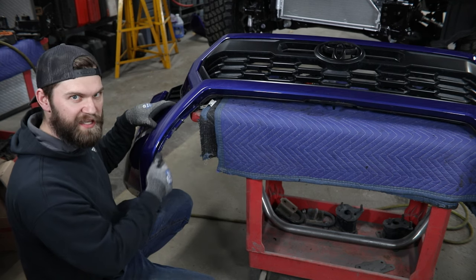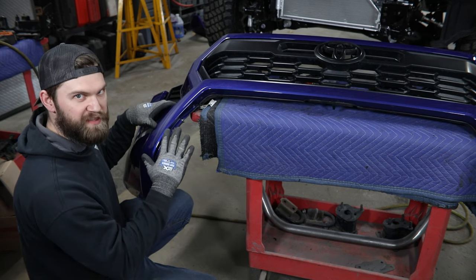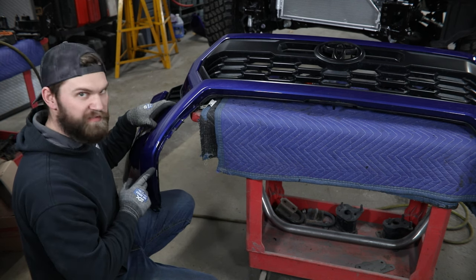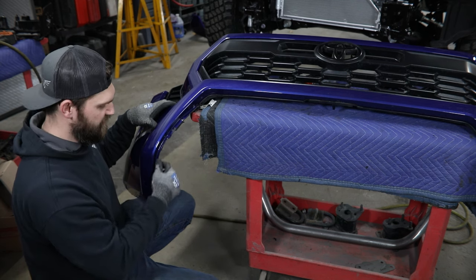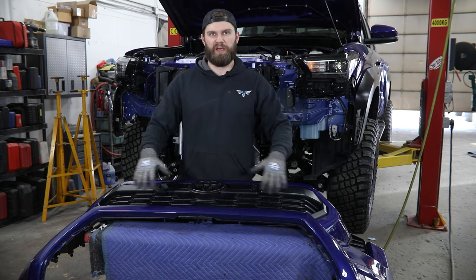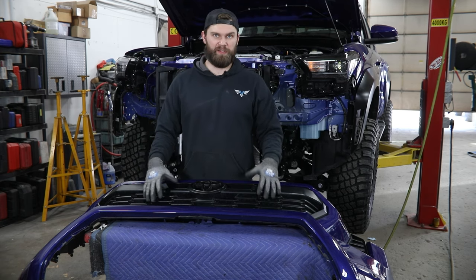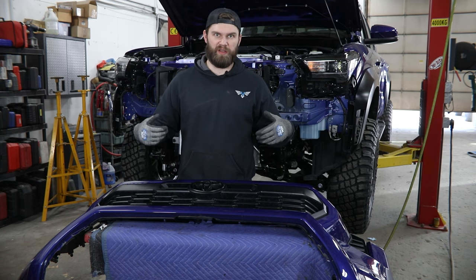Flipping this over to show you what it looks like from the outside, you can see you're left with about a three-eighths to half inch wide flange along here. It's nice and smooth along this edge with maybe just an eighth inch of material hanging down, pretty much all the way across. There are a couple tabs on here that kind of have to be sanded down to make this a nice flat surface — depending on the color of your vehicle, you might want to mask this off and paint that inner flange black. Once you're happy with your cut, this assembly is ready to go back on the vehicle in pretty much the reverse order.